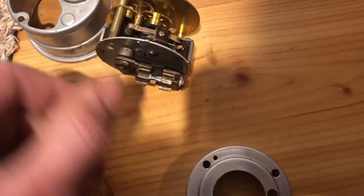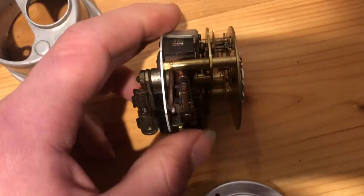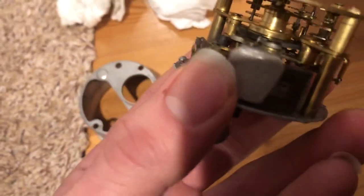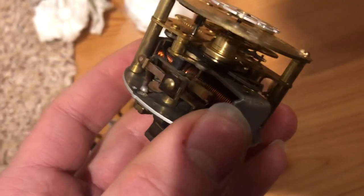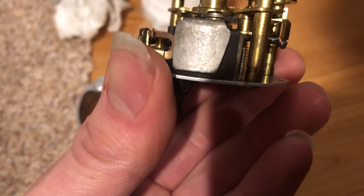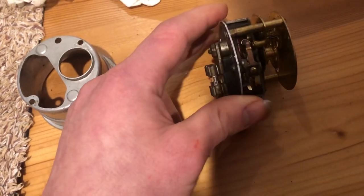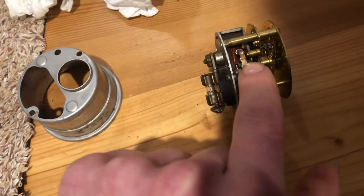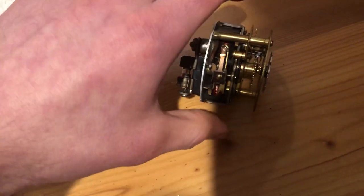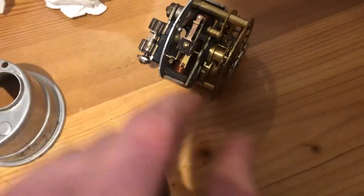There will be one wire that's secured here, then go through the fuse and then into that contact. When it needs power, that little switch will close and energize this electromagnetic coil that you see through there. It moves this bar up and that winds the spring. It goes through its wind fairly quickly, and depending on how good of a charge it got — the little contact only connects for a very short amount of time — sometimes it won't fully reach the top, so it may cycle sooner rather than later, depending on how well that system is working.